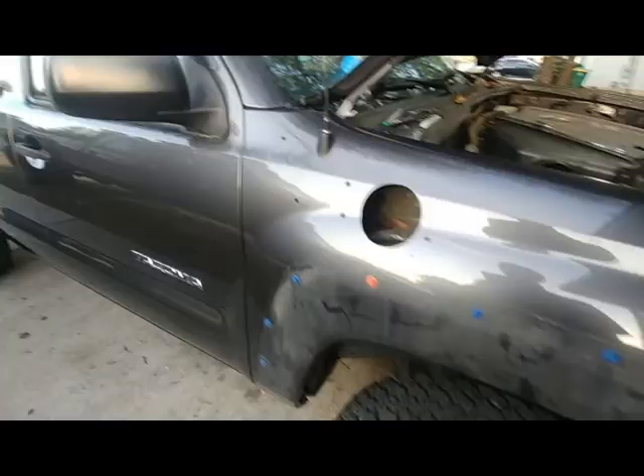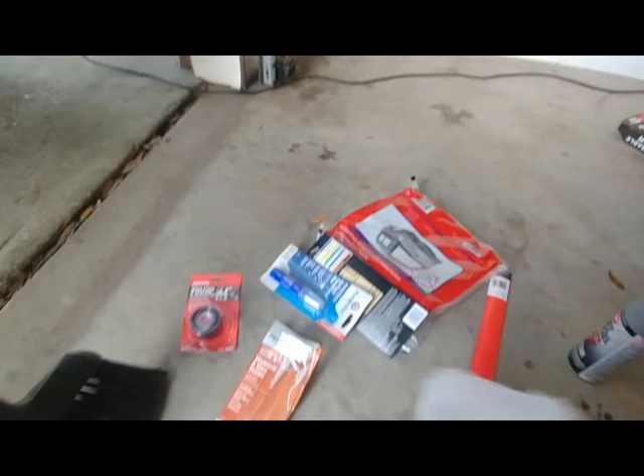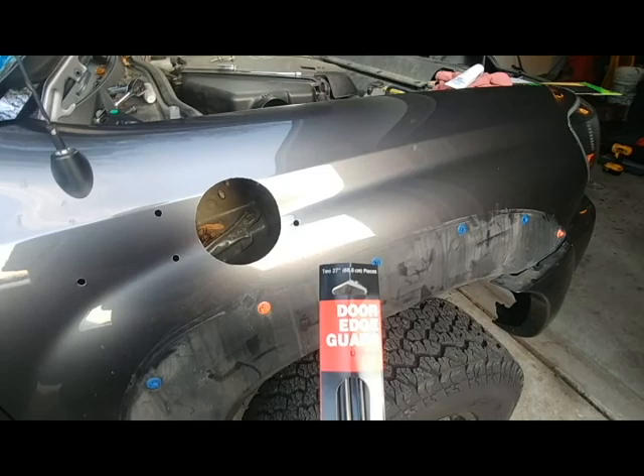Finishing touches before everything goes back together. I've bought windshield and glass sealant — I used this stuff before on my roof rack. Water can run down the threads and you can get water inside the vehicle, so I put this around the top of the bolts and on the threads that go on the A-pillar. I've also used insulating and sealing wrap under it just to keep it from rubbing on the body and making any squeaks. I'm going to use some 320-grit around the hole, smooth everything out, and then use door edge guard — I found it on one of the Toyota World forums. It's pretty stretchy and I'm going to put it inside the hole so the snorkel doesn't scrub anything.